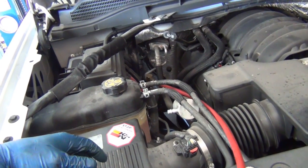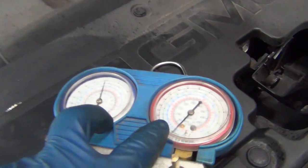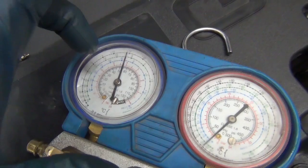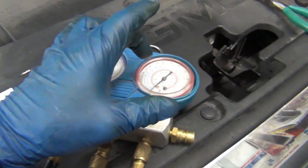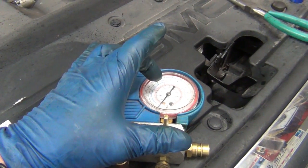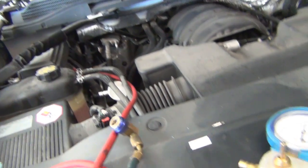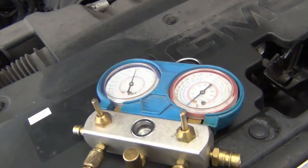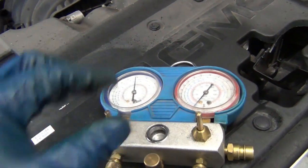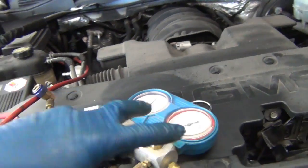That's why we had the slow leak. If you've got bad readings and something doesn't seem quite right, it seemed like the valve wasn't closing because I wasn't getting the pressure difference I should. On your low side it should be at 35, and on your high side it should be up around 200. I couldn't get it above about 160-165, and that's because aluminum stuck in that expansion valve means it can't close off enough to create the pressure difference and give you good AC.